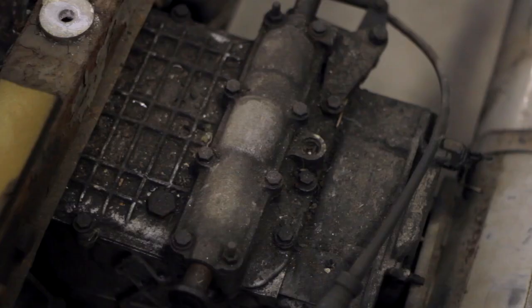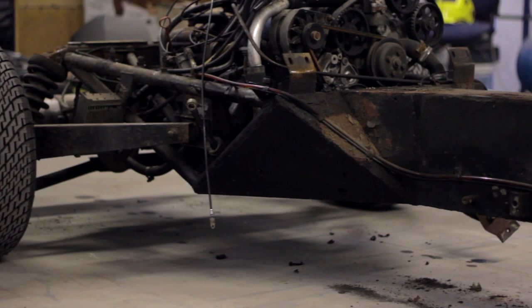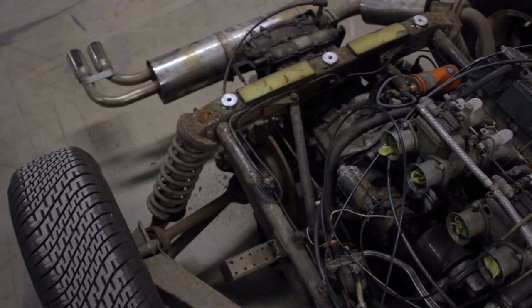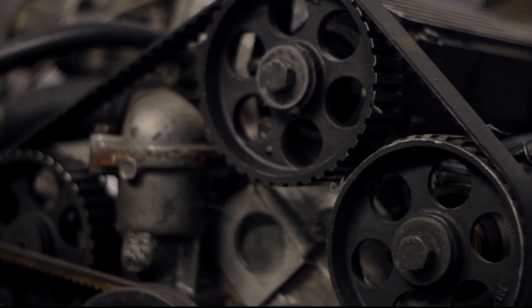This is the Citroen-Maserati transaxle — it came out of a Citroen SM. It's a decent transaxle; I'm not sure it's rated for much more power than a Lotus can give it, but it's certainly strong enough. Coming from it are the inboard brakes — the pinnacle of F1 design at the time — and the Chapman strut, where your drive shaft is your top link. You've got a trailing arm and the drive shaft creating what would be almost an upper wishbone, a lower link, and the coilover unit. Because the drive shaft also carries the suspension burden, it eats the universal joints, and as Ian Harbin noted, wheel bearings get a fair hammering too from the cornering forces this car can handle.